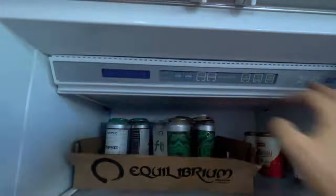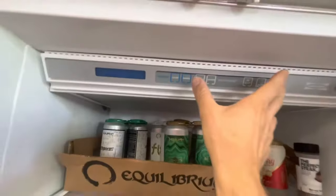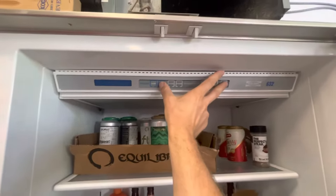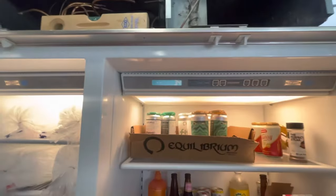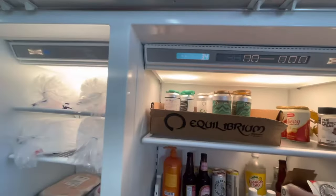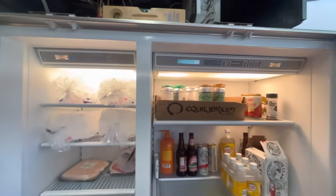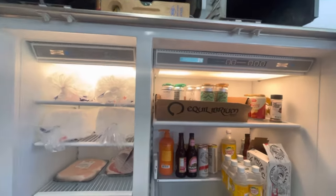Turn the machine off completely. You're going to look at freezer and warmer. We're going to shut off the freezer first — you're going to hold warmer and hit on-off. Turn the machine back on. It will read minus 34. Now what's going to happen is your computer is going to send power to your refrigerator and run your refrigerator as normal and then not run the freezer.